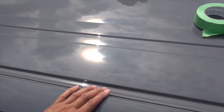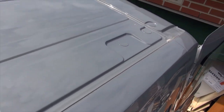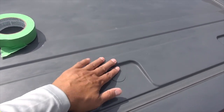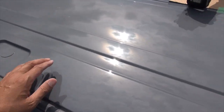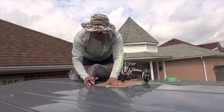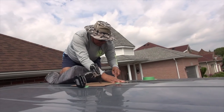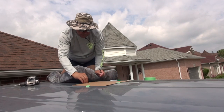On top of the roof there are little divots here and there — that's where the cross members are, the strongest structural points. When standing on the roof we have to stand in those positions on the side — that's where we put all our weight. If we go between the cross members, it's too soft with nothing to support. Now that the template is in proper position, I trace it with a black marker, then remove the drill and the template.